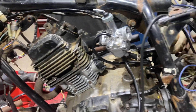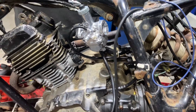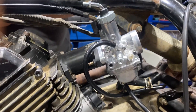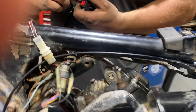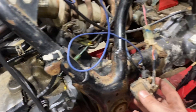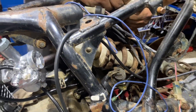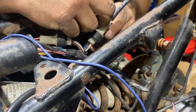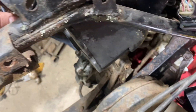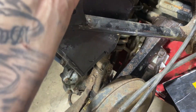We're going through diagnostics with this machine. We put a new carburetor on it - this Chinese carburetor is shiny. We're trying to figure out why the starting circuit isn't working. If we bridge the starter solenoid it works, but I'm thinking the starter relay is no good. This one tried to turn over at least. The relay is right here - this one's got the piece on it.